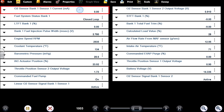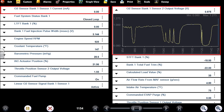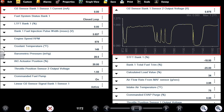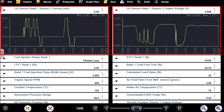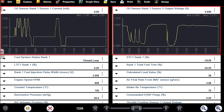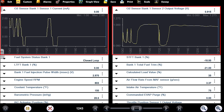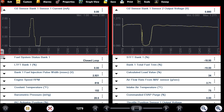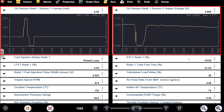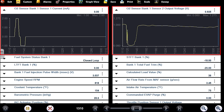I should see some type of milliamp changes here and it's pretty much stuck at zero. When I snap it a couple times I can get it to change. Let's do a decel fuel cut — watching that downstream sensor. Anytime you have a rich condition you question the sensors: are they reading accurately, both upstream and downstream? In this case I have an upstream that really isn't moving all that much. I'm not sure of the data parameter range — usually about a four milliamp swing on these things.